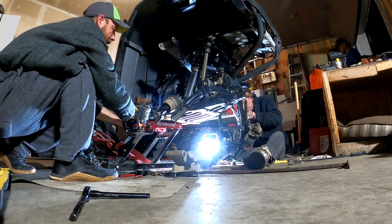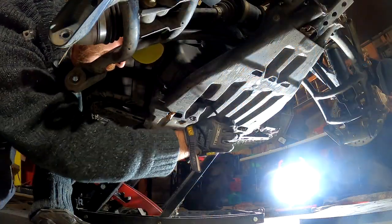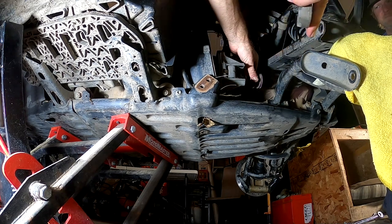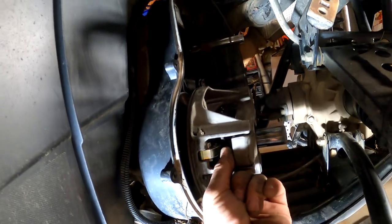Oh, hey, I just got a clutch kit for my bike. Is there much to changing the clutch kit? Depends what kit you want to put in. Well, we just bought the QSC clutch kit, the full kit. So the primary is easier to do than the secondary. On the primary, I'm going to be able to take the face off of it, and it doesn't have that much tension. Yeah, like it'll have tension, but if you back the bolt out equally and evenly.